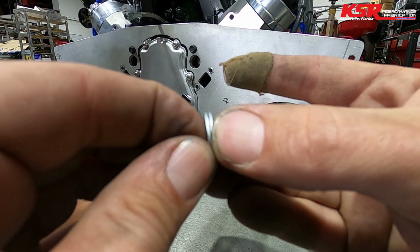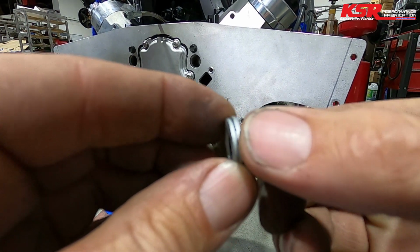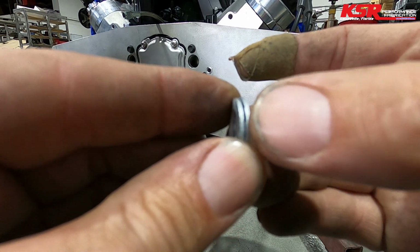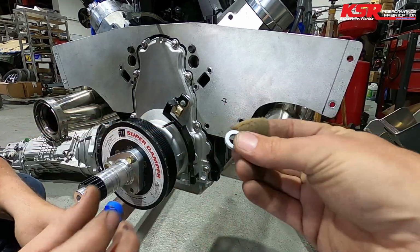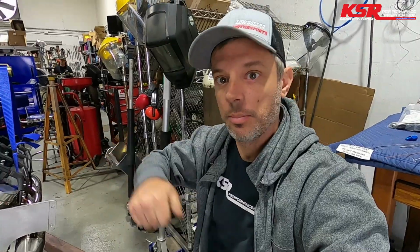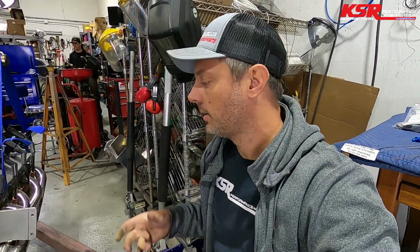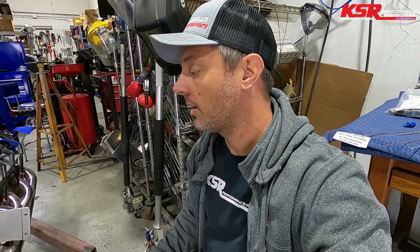And then for them to loosen, they actually spread apart. So watch the gap. I don't know if this is going to work or not, but you can watch the gap between the washers actually grow. So what has to happen there is for the bolt to loosen, the washers have to spread apart. So the only way that's going to happen is if you're really putting a lot of load on it with a ratchet. Little vibrations and stuff like that, it's not coming loose. So we use that on like brake calipers, brake caliper mounts, anything we don't want coming loose.